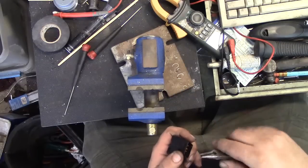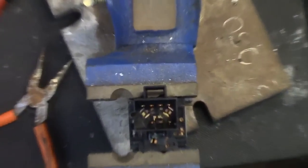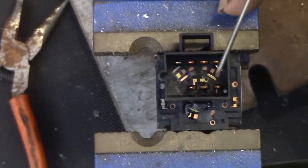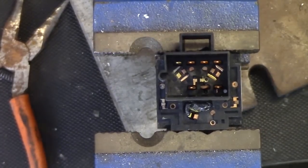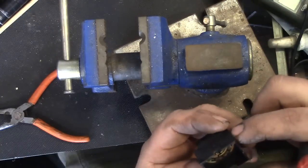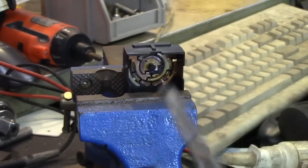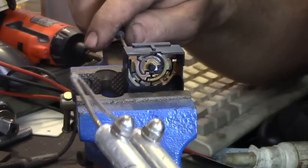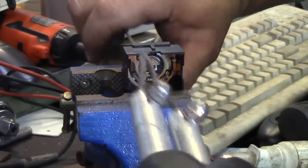I guess I could just take a soldering iron and heat that up again in order to get it free of that plastic. And I thought of taking a closer look at the terminals. See, there is a little bit of melty bits around that one there, where the plastic oozed through from the heat. Down there. And I've got to try to heat while pushing at the same time. Well, I'm going to be heating on that pad and trying to push it from the back side. I'm not getting any luck going from the front. Sure, this is nice and warm.